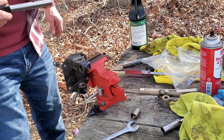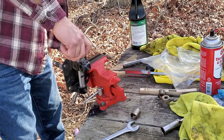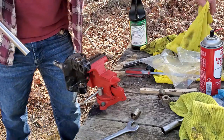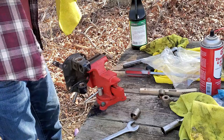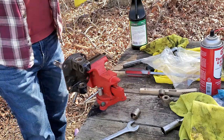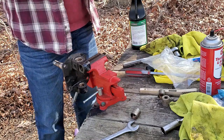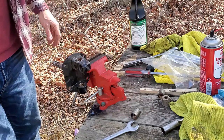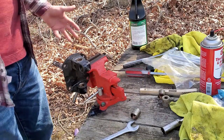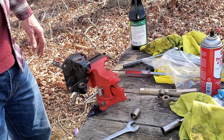This is the right side of the car. I almost wasn't going to do this one because it had just a slight bit of wear on it, but that's kind of crazy not to when you got the whole set and you got the thing apart already. Anyway, there you go — that's installing kingpin bushings and reaming them. That's driving the old bushings out, putting the new ones in, reaming them out. Beautiful fit.